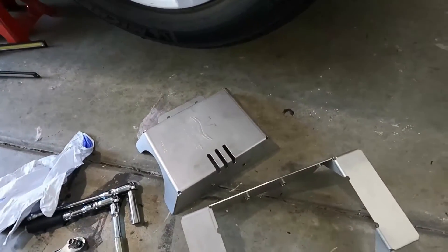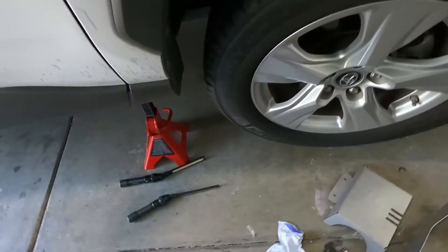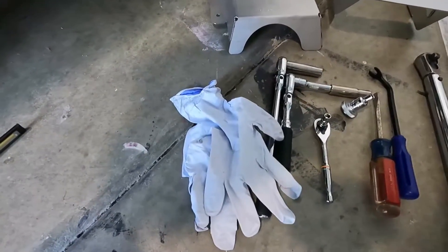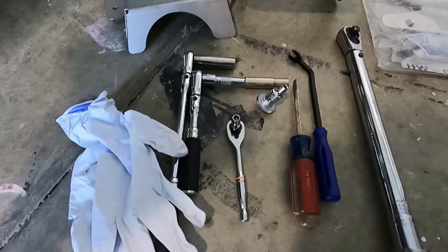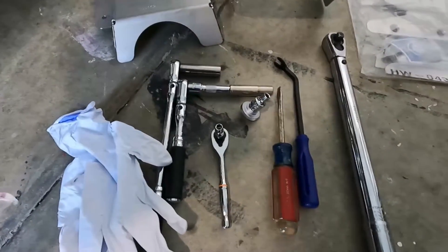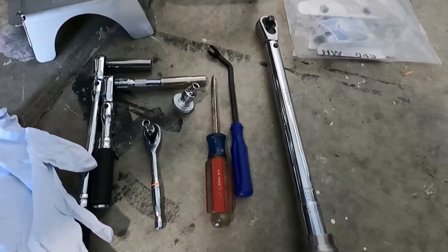This one's a little bit different — it's more of a cage or a shield around the catalytic converter. Got the car lifted up and on jack stands. As far as the tools needed, you should have protective gloves and eyewear, a 10, 12, and 17 millimeter socket, a quarter inch bit driver, a small quarter inch wrench — ratcheting would be great — and of course a ratchet and extension, a small flathead screwdriver and/or a trim tool, and you're also going to need a torque wrench.